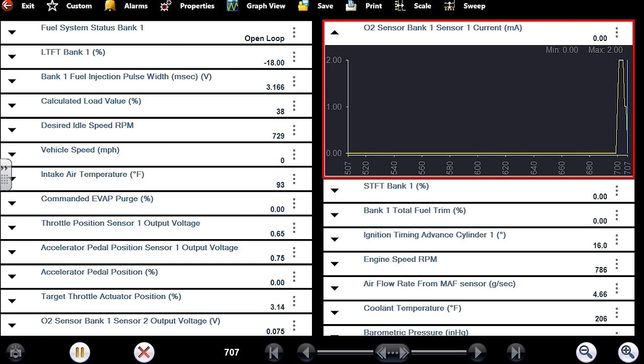A review if you're unfamiliar with the OEM data you're looking at: exit out and go to global mode — a lot of that data is very uniform and will help you understand what you're looking at in OEM format. An example is Nissan with their short-term and long-term alpha fuel trim where 100 equals zero. When you go to global data on that same car you'll see short-term and long-term fuel trim listed as a zero percent number instead of 100. Sometimes widebands are reported differently on global versus OEM.